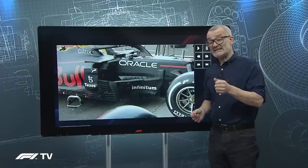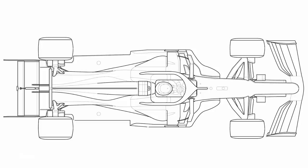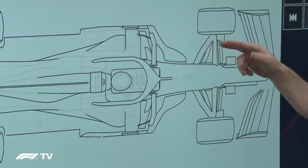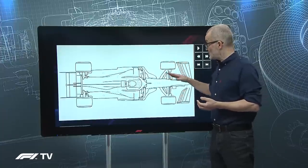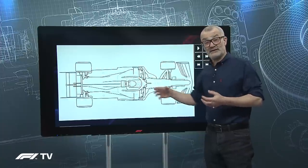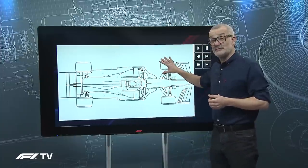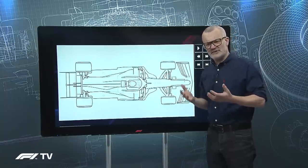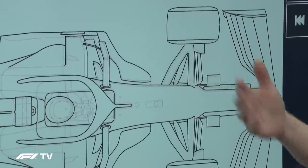So what exactly do they do? Let's have a look — I've got some drawings to show you. When Lotus first introduced the barge board in the late 80s it was just a little vertical vane behind the front tyre, and its function was very simple. The turbulent wake coming off the front tyre was pushed outwards by this vane and therefore pushed away from the central bodywork, making the central bodywork more efficient. Regulations then banned bodywork in that area, and subsequently we had what we would now more describe as a real barge board — the rectangular boards sat in that little section in front of the side pod next to the cockpit.